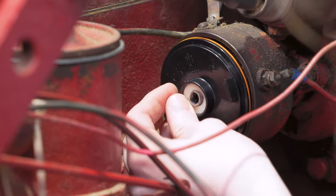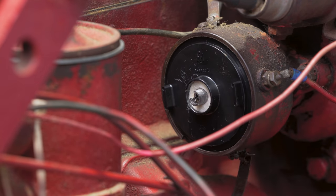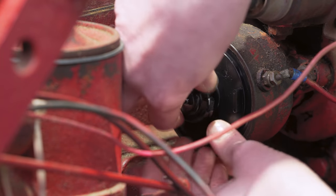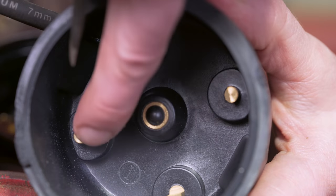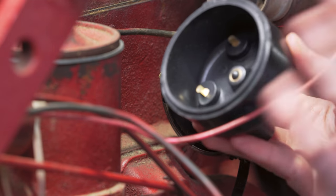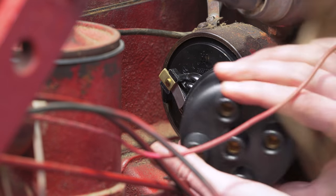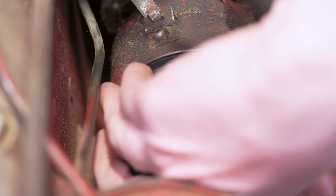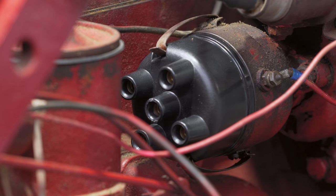The next piece to put on is the dust cover. The felt in the middle — make sure it's stretched all the way around and it snaps down; you can hear that it's all the way down into the groove. It'd be easy to just set it on the outside, but make sure it's all the way in. Then you can set your new rotor on — it only goes on one direction, so just slide it around until you find the spot where it's going to seat and then press it into place. After that you can put a new cap on if you please. Inspect your old cap and if any of these tabs or the center carbon piece are broken or burned you would definitely want to replace it. Notice on your cap there's a little notch right here and it matches the notch on the bottom of your distributor — notch to notch — and then bring your metal straps down and they just snap right into place.